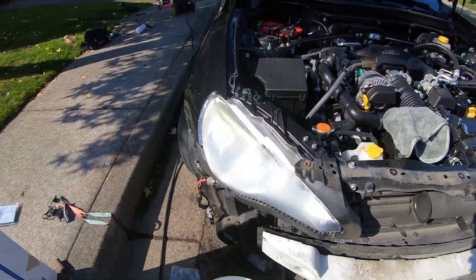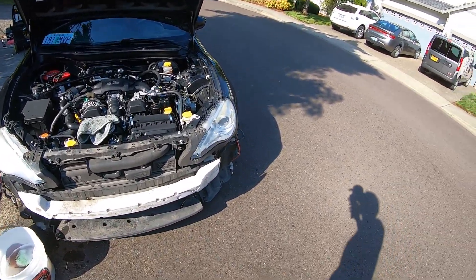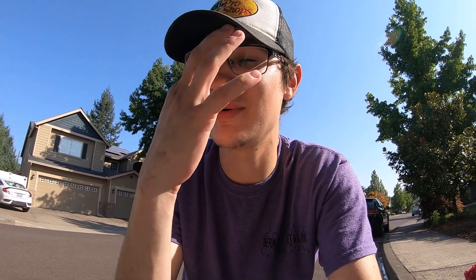You can see the very rough scratches — it is super foggy compared to the other headlight that hasn't been done yet. But as we increase the grit size of our sanding discs, the finer the scratches will be and the headlight will start to look a lot clearer. It won't hit that magic clear spot until we get done sanding and start polishing and compounding it. So let's move on to the next step — 1,000 grit.